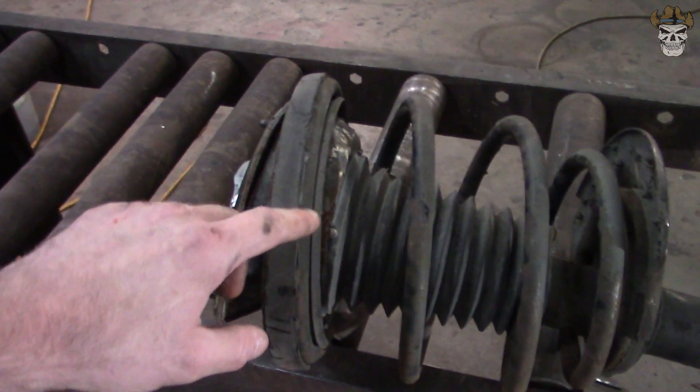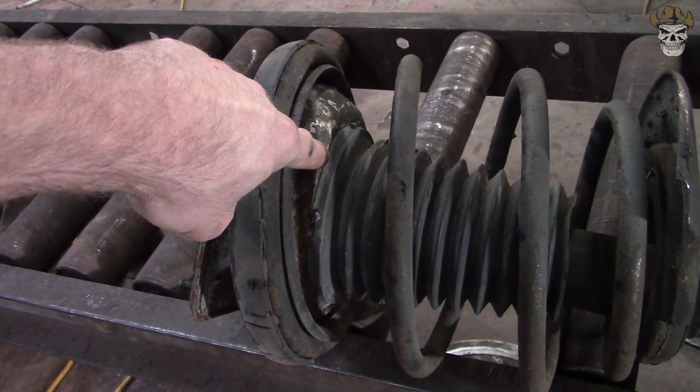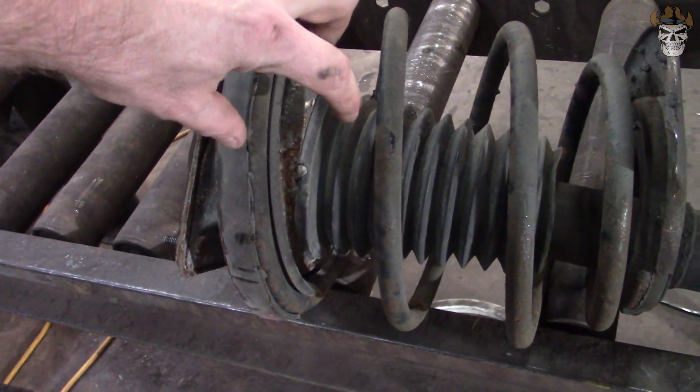What I want to do is the same thing I did on my blue Oldsmobile — we're going to take this spring plate, cut it down, gap it an inch and a half, and all together that will end up giving us about six and three quarters of an inch, because the inch and a half there with the thickness of the steel comes out to about an inch and three quarters. This thing's gonna look good, I can't wait.